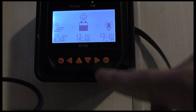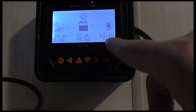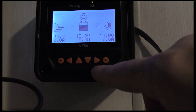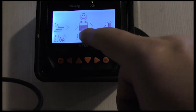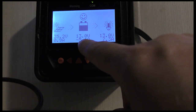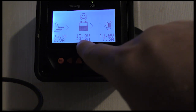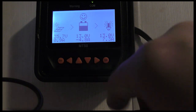Our panels really aren't bringing much because it is very, very overcast — we're expecting a heap of rain today. As far as the EPEVER controller goes, this is what we're taking as the load — 7.7 amps is going out to the heater. We are making 0.8 of an amp from our solar panels and since it's an MPPT it's making the conversion — 13 volts going to the battery. The minus 5.1 is the difference between the power we're making from solar, what we're sending to our load, and what we're taking out of the battery — so we're currently pulling 4.8 amps out of the battery.